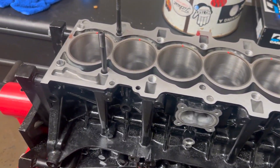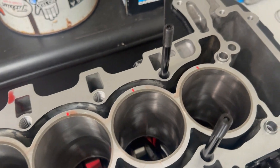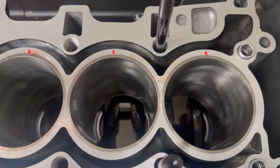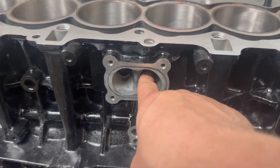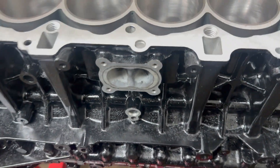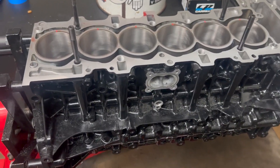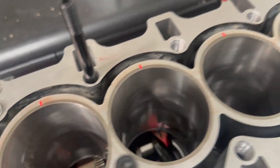I did this off camera but figured you'd want to see it — I did the NS300L inserts that fit the head studs to make them stronger. You can see them all in there. This took forever but I tapped all of these and put the inserts in. I'm also running four dowel pins — I've never seen anybody do that but figured I'd try it. I left one stock because someone on the forums said that one is known to crack if you drill it out. Here's my block — check out that cross-hatching in there, looks good. And here's my dog Nala, she wants to sit out here with me. I'll catch you on the next one.